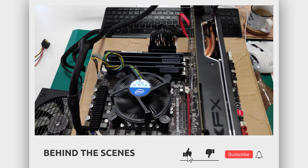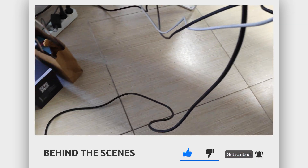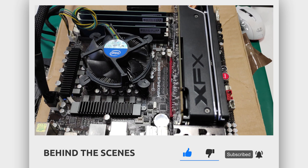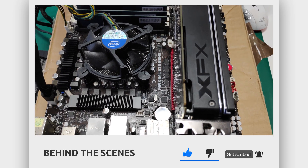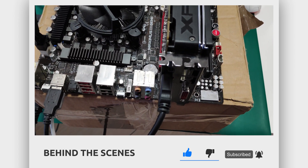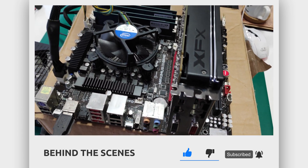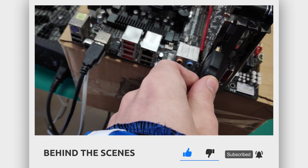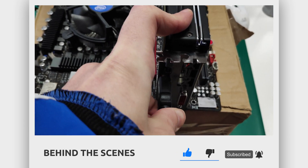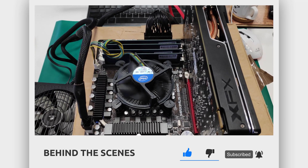So this is what happened after I cleaned the motherboard and did a quick test. The CPU fan was spinning without any power connected to the board. Obviously it was from the HDMI cable, because that was the only thing connected to the board. Unplugging and plugging it back confirmed that, and I was shocked how it was even possible. Then I realized that the other end of the cable was not connected to my monitor, but to my running PC.